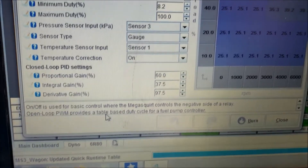You have a prime duty cycle, minimum and maximum duty cycle, and inputs for capturing pressure and temperature, then the proportional, integral, and derivative gains for the PID loop to control how quickly the fuel pump reacts. The plan is to do a couple of half-throttle pulls to see how well pressure keeps up with demand, then keep adjusting the settings. That concludes the returnless fuel pump system overview. It probably would have been simpler to buy the Ford fuel pump driver module, but this gives more flexibility. I'll provide a follow-up to see how it's holding up.